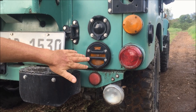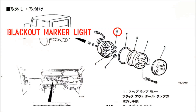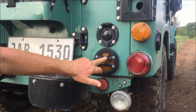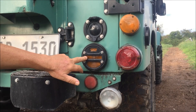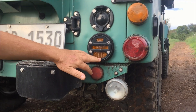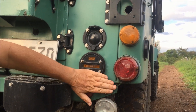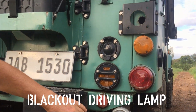The tail lights have three lamps with a lens plus a blackout cover, which my Jeep is missing. The top bulb is the marker light at just six watts, and the lens cover holds the distance wedge marks. The middle bulb is a blackout stop light. The bottom bulb is also a tail light — a 12 watt bulb wired in parallel with the service tail lights, with the lens cover covering it completely. The covers might go on only for maneuvers or in combat, or are removed if the usual service tail lights fail.